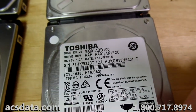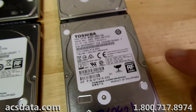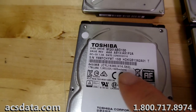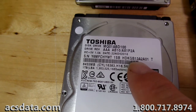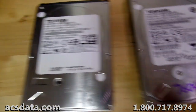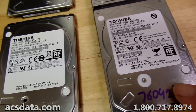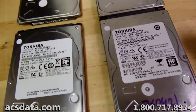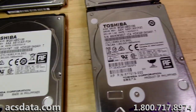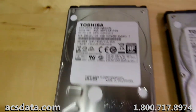We know that that drive is compatible with this one though, because we've already used those heads out of the similar drive here that the customer sent. Basically he's bought 2 parts drives, it looks like, that were the same model number with just that one deviation. So we've used the heads out of here, and those are the heads that are actually in this drive still right now that had the issue where they did the same thing as the other parts drive we did and just worked for a little while, slowed down, and then eventually just failed. So we do have that as another backup.